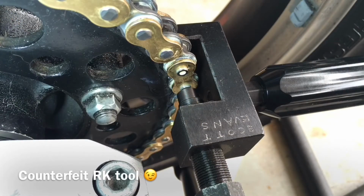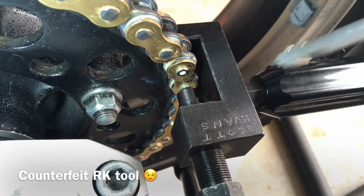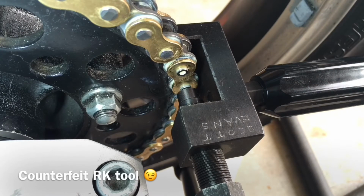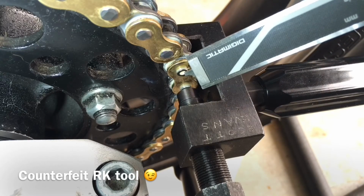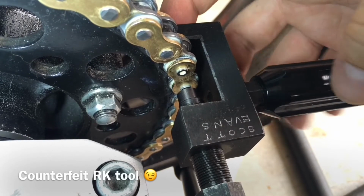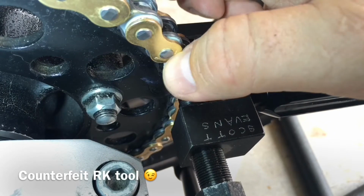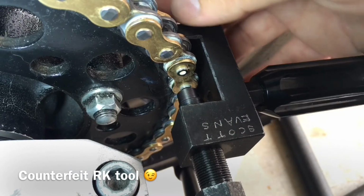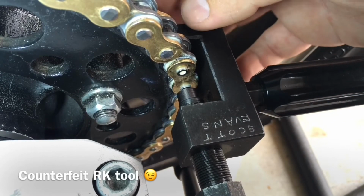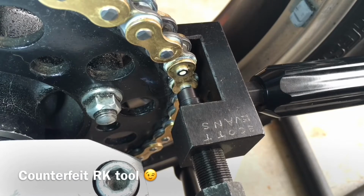So what we do now is we put two different pieces. We put a tail piece and a piece that peens over the head of the pin, and you can nicely see the one piece that's inserted into the tool here. It has a little dimple, more like a nipple. It sticks out and it fits into the hole right there. And I'm on the bottom rivet right now. The tail piece in the back end right now is critical because it does have what is more accurately known as a dimple to accommodate the rivet that's already there. We're putting most of the pressure on the back side on the side plate, but also the pin too, to press the pin head down. And there's a dimple in the tail piece, which I'll show you in some cutaway shots here.